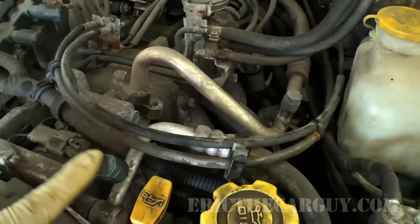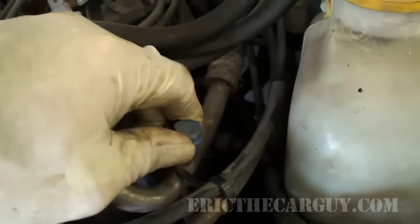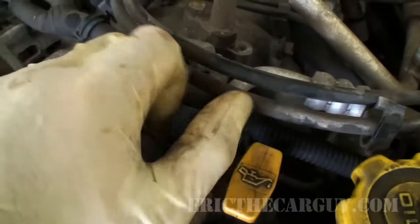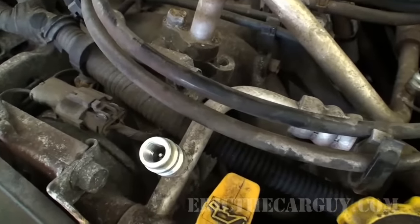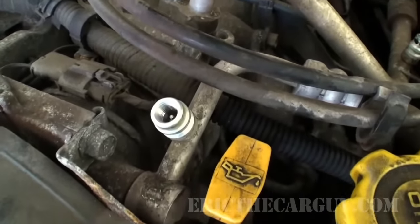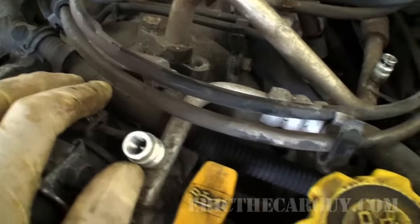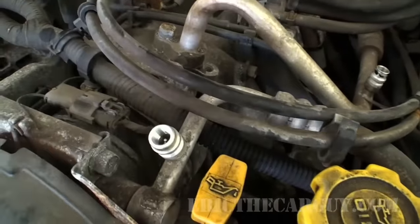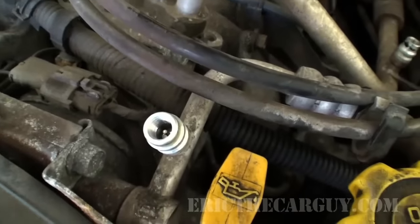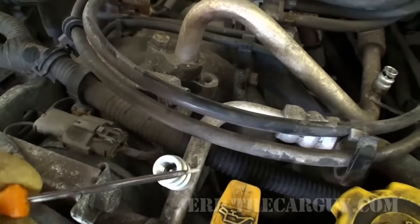You've got a high pressure side — big H — and a low pressure side to AC. This system is an R-134a system. Anything older than about '96 has an R-12 system, but that should really be converted because R-12 is not sold anymore, and if you can find it, it's prohibitively expensive. Most conversion kits involve changing the fittings, which are very different from the R-12 fittings.